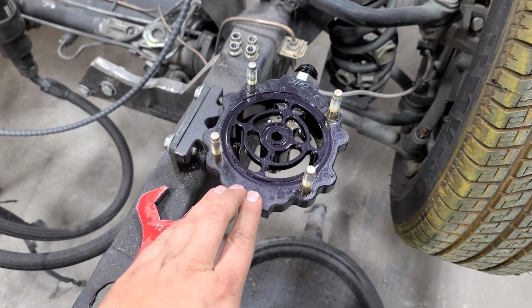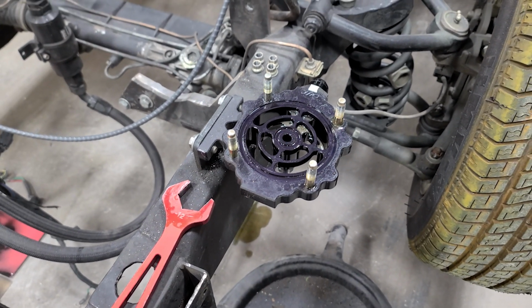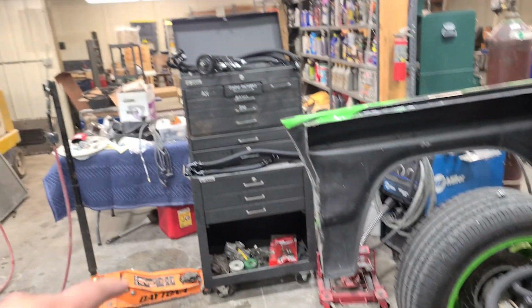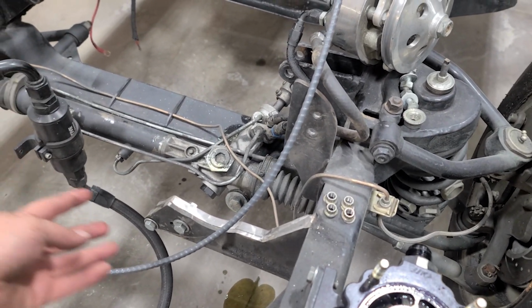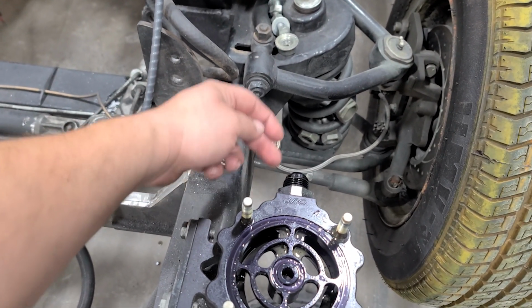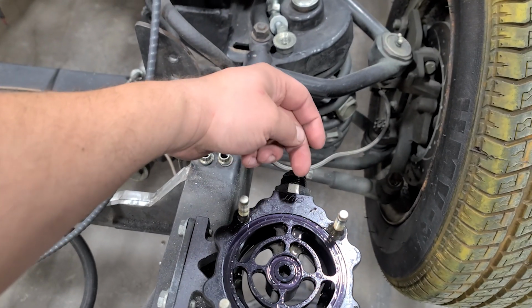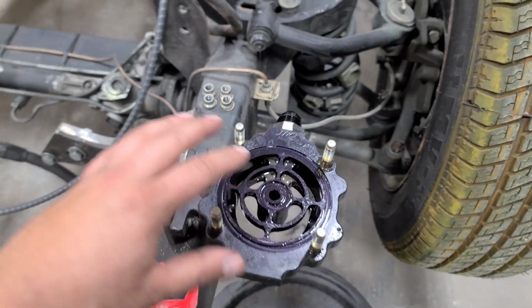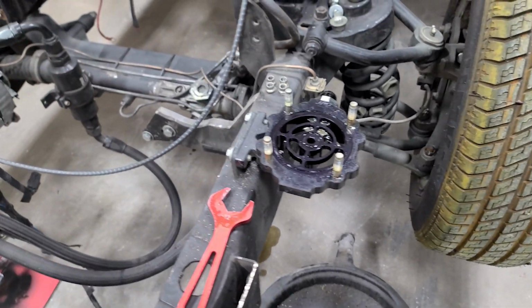And I just wanted to give you guys another little instance of the Clearview filter system and why we believe it is great. So if you guys don't know, mounted up here on my driver's side frame rail is our Clearview. And from our dry sump pump, which is usually mounted right here, it's actually sitting in the top of the toolbox because I just cleaned it. But that's mounted here. It sucks oil from the oil pan into the pump. We'll actually pump the oil up. This says out, so the end is on the upper side. I got the upper hat off of here. Comes in through the filter, back out, and there's a screen in here. So you're screening through the Clearview, and you're also screening through a filter, and then obviously pumps the oil to the motor.